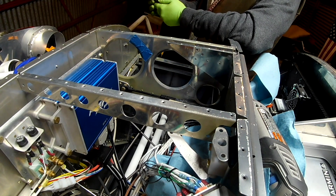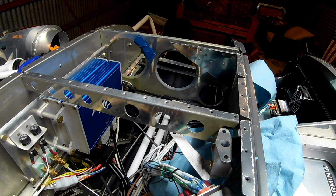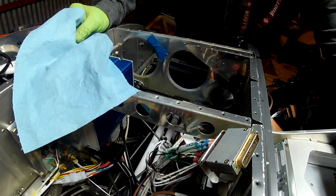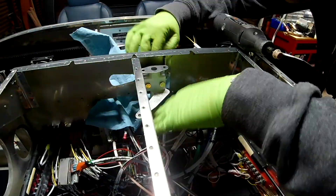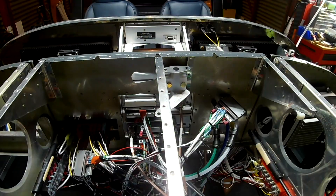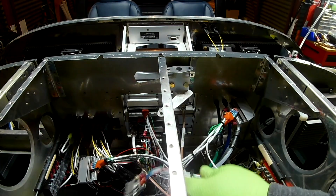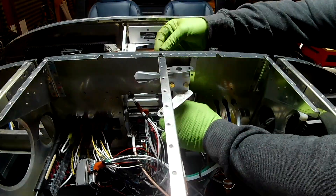We're actually undoing some wiring, which always makes me unnerved. I've got a couple of work towels in there and my Dremel out. Along the very top of the center stack, the autopilot controller is followed by the audio panel, and the wires that come out of them go back behind. The opening for the hole in the sub-panel is very tight, so I'm going through with a Dremel and then a file to make them bigger. I'm wrapping all the wires in extra silicone tape and also putting a grommet ring around it to protect the wires from getting chafed.